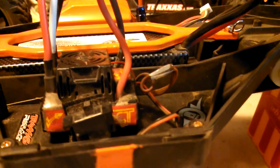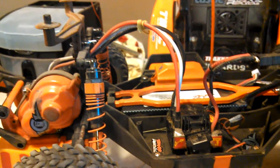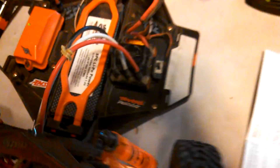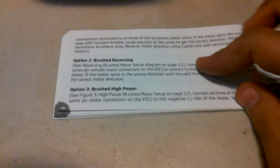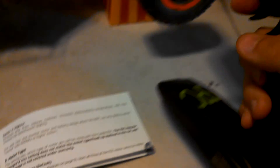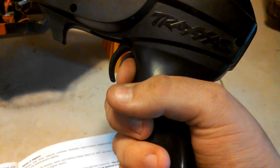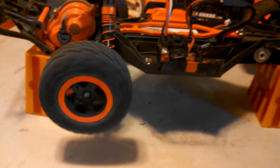So it's nine, one. If you don't have your motor plugged in, you will not hear these beeps — but there will be a little light flashing you can count instead. Motor type: brushless — yes, I am running a brushless motor. Your other choices are brushed and brushed high power. I'm going to choose option one. Throttle. And now you're done — now you're programmed, and you're good to go.